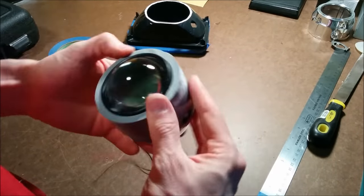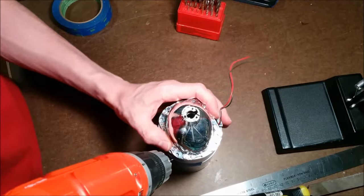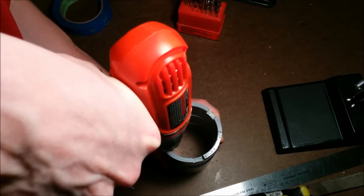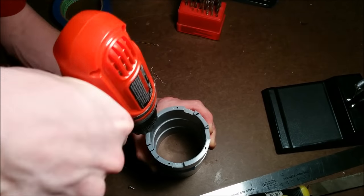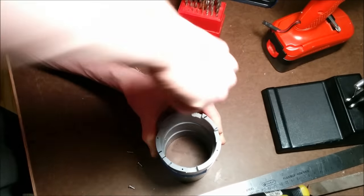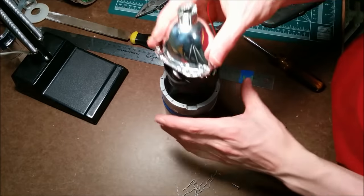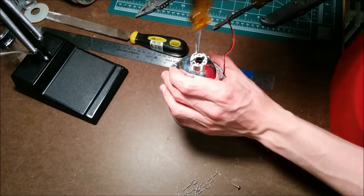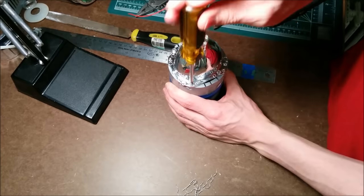I was at this point where I started to attach the projector to the shroud. I used a small drill bit to make some marks and then drilled straight down into the side walls of the conduit to make some pilot holes, and then used some small screws that I had laying around to tap the holes. Then I just used those screws to attach the headlight housing to the conduit, and that made a really strong connection.